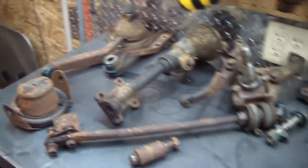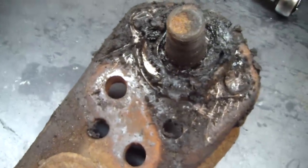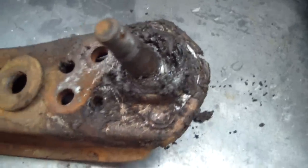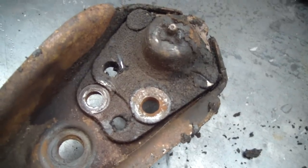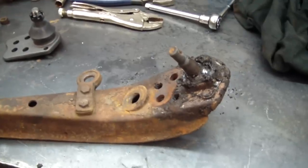Here are all the suspension components for just one side of the Javelin. That bushing was worn out. The grease boot was completely ripped apart and it looks like something was wearing on that grease boot retainer. The ball joint is actually still pretty tight though — it's held on by two rivets there and also held on by the strut rod when that gets bolted on. I got another one from American Performance here — since we're re-bushing the whole front end we'll throw a couple of ball joints in it.